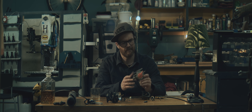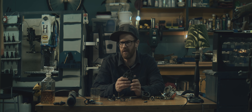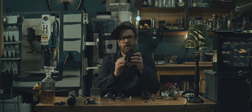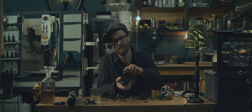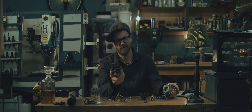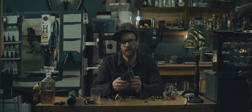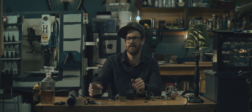I've pulled off the carb and I'm going to try using something I know very well, as opposed to this pumper carb - a PWK 32mm. It's smaller but it should work. After some persuasion with a file, the bolt pattern matches the other carb, so this is bolt-on. Let's assemble it and hook up everything and tomorrow morning we'll try with this carb and see how it behaves.